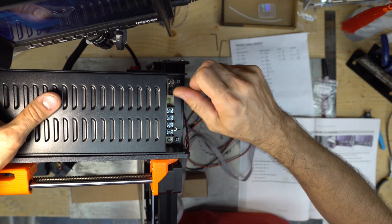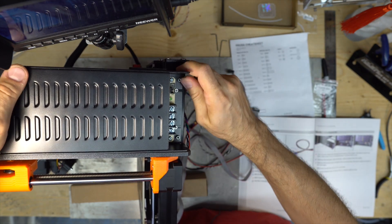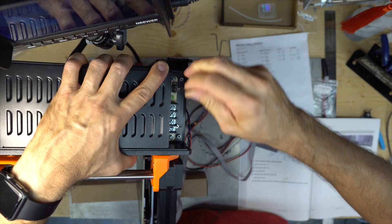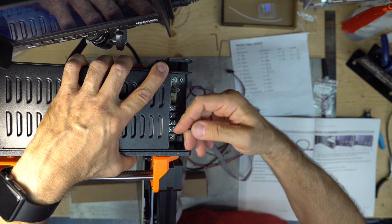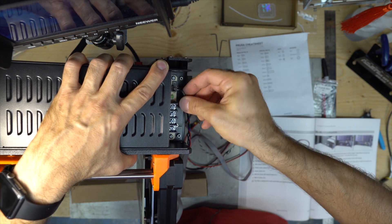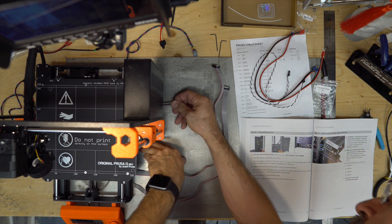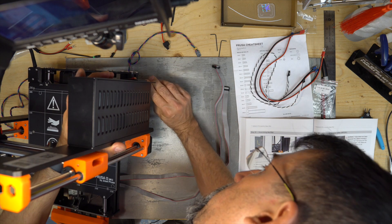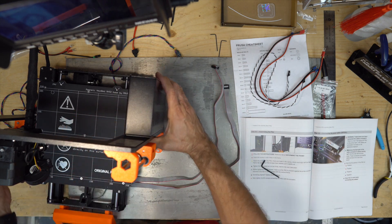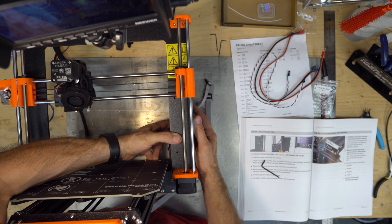Screw and it should hold up on its own. I'm moving it flush to the frame. So you put it up to the frame — not too firmly, you need to adjust later, just enough so that it can hold upright. I'm going to unscrew those two a bit so that you can move the power supply up and down. You push it in, then you have to align the screw holes. So you have to move the power supply up and down until you see the holes.